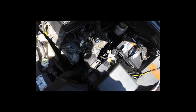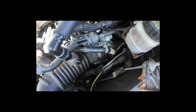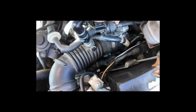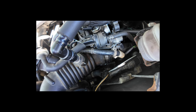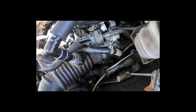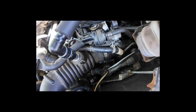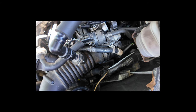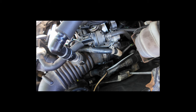I did, however, put a quick release on for the battery. We're looking at this piece right here. It's literally right there, so easy to get to. What I want to know is whether or not it is working properly, which I can check for continuity, or I'll just get a 12-volt connection and see if it clicks on and off, because that solenoid in there should pop on and off when I do it.